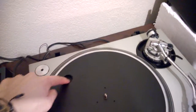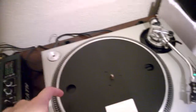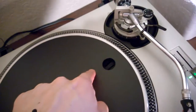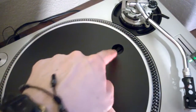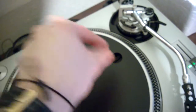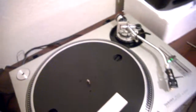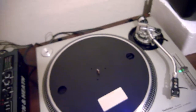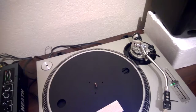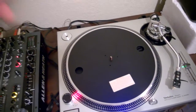you can take this platter off, put your fingers here like this, and pull it out. Unscrew this platter, and right over here, around here, there's the brake adjust. So you can, with a screwdriver, adjust that to your preferences. I mean, some people like the platter to stop really fast. Some people like the platter to stop really slowly, or start really slowly and get that old school feeling,